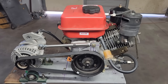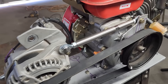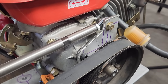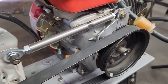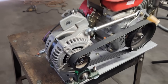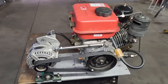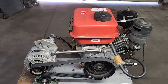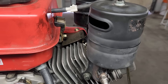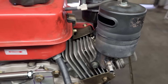This little diesel engine appears similar to the 212cc gasoline Predator engine, but it's not a direct replacement — you can't just swap engines and have everything line up. The diesel engine needs to be offset about 1 inch or 25mm in order to get the pulleys to line up, and that was a big enough difference to make the diesel not fit in the same space as the Predator engine. We had to shuffle around all the stuff to get this to fit inside the Desperado. I'm going to say it fits, but it doesn't fit good — and that's fine. The Desperado is a less than perfect contraption.